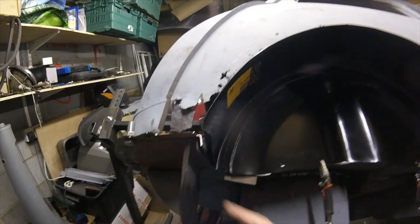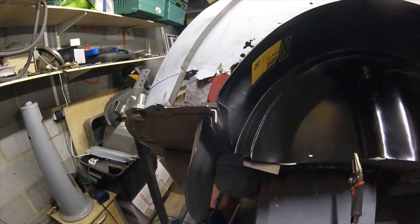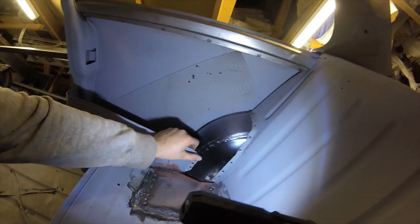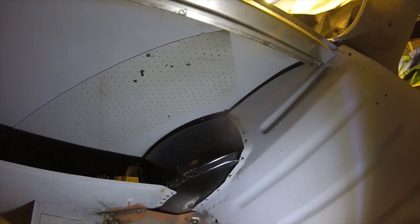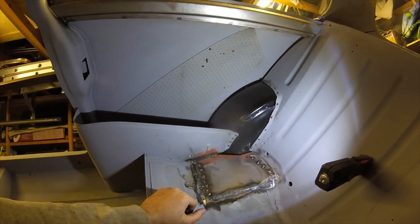As far as I can tell, that's where that goes - so that's the back edge, and we've just looked at the front edge as well. Final place to look is inside the car. The companion bin is just squashed back there; we'll be able to plug weld those and weld all around there. I'd say that is pretty much bang on - says a lot about heritage parts.